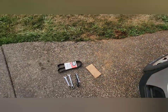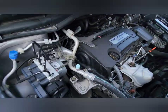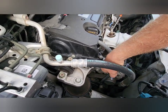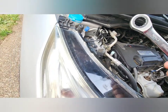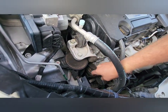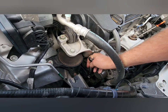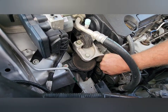What you're going to want to do is take your 17mm and go in here and put it on the tensioner arm right here — so it's going to go like that. Now, I'm going to show you a little trick. This tensioner you pull towards you to loosen it, but as you can see, it's really tight in here.